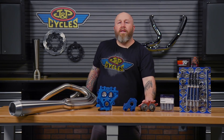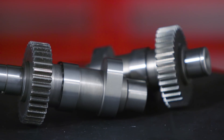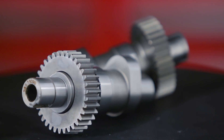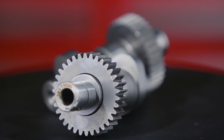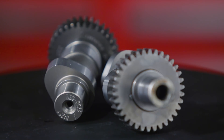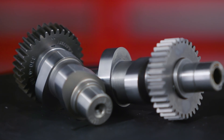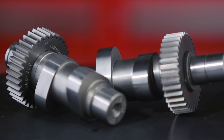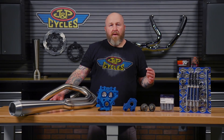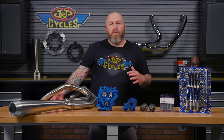The next thing you're going to want to choose is a cam. Choosing a Stage 2 cam can be a little bit tricky, especially if you're going to build for Stage 3 and 4, because you don't want to over-cam your motor. Some bikes nowadays have valve springs set up to handle a higher lift cam, but you really don't have the compression in a stock piston motor to support a big cam. Cam selection is important — you don't need the biggest lift cam out there, you just need something that's going to give you good low-end seat of the pants power and torque.